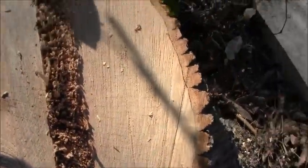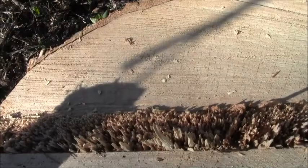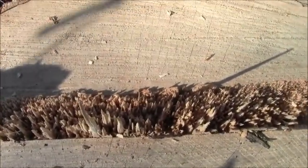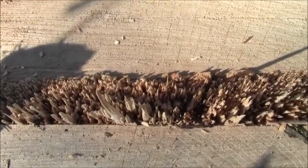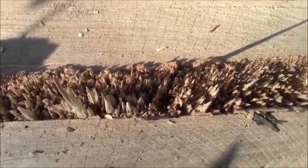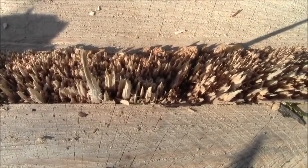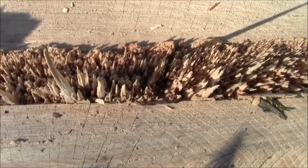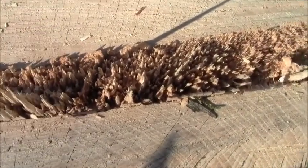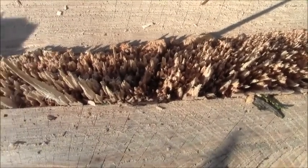Another thing to look at is how thick your hinge should be — that's a big topic. Your hinge, they tell us, should be up to 10 percent of the diameter of the tree. So a 20-inch tree you might make a hinge as much as two inches thick, although that's getting pretty thick. This one is one and three quarters. At some point your hinge will be thick enough that it won't want to bend and you'll split your tree.